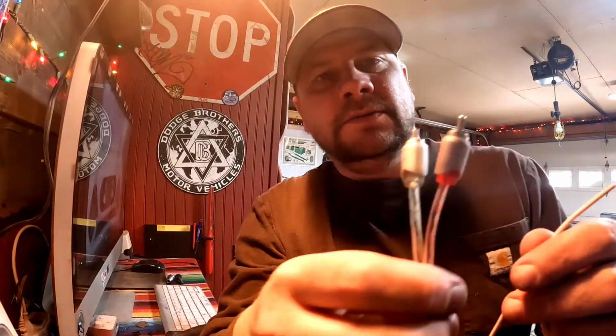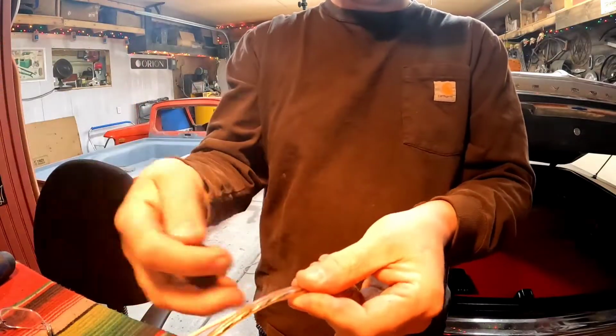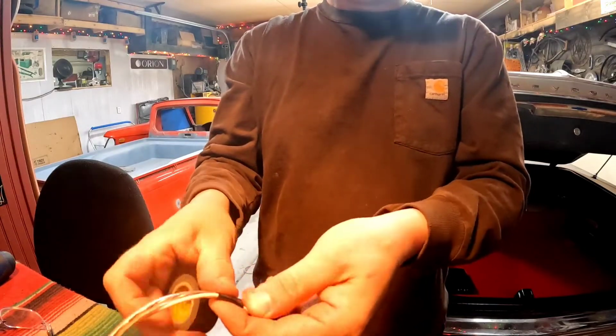Got my RCAs here. Need to go up to the radio. I also need to send back a remote turn-on wire. I usually like to use blue for this, just because the remote wire on the radio is blue. Blue and white. Fresh out of blue. We'll go with pink. What I like to do to keep this more manageable, I'll tape the remote wire to the RCAs every foot or so. Hang on to these for me, will you?